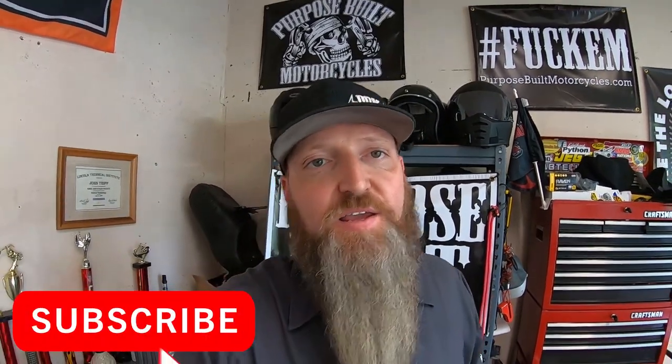What's up guys, welcome back to the channel. I'm Trip HP Junkie and today we're working on the Dyna. We're gonna do a 5,000 mile service, which is basically an oil change, transmission change, and primary change. First thing first, let's check out the fluid. This is totally up to you — we can start a conversation for hours on fluid types. I've always been a Mobil 1 V-Twin 20W50 guy and I've used it in all the bikes with no issues whatsoever. For the oil filter, you can get all this stuff at AutoZone or O'Reilly's — you don't have to go to Harley Davidson. With this 5,000 mile service, we normally like to do a nut and bolt check of everything, and we're also gonna do spark plugs.